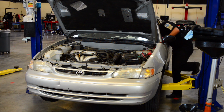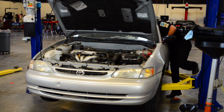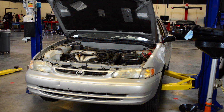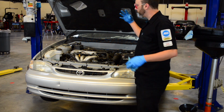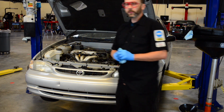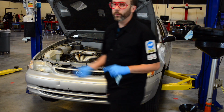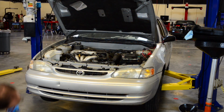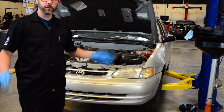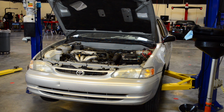Honk! Okay, my oil light went out. I want to make sure nothing is spraying oil on the top, like we didn't leave a cap out or we didn't have a dipstick that's not put in right. And we're going to look underneath on the bottom and make sure that we don't see any drips, anything pouring out. And once that's the case, let's turn the vehicle off and check the oil one more time.